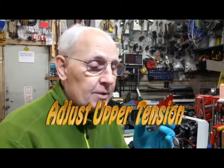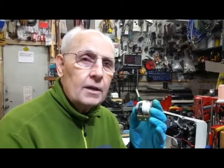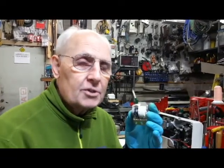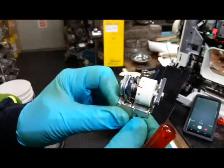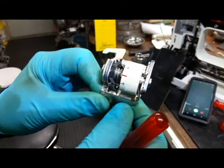There are problems with this tension — generally oil varnish, which is what we're finding largely at this point in time. Machine oils are now varnishing up. This is a top tension out of a Bernina 1080 machine. The same tension is found in all the 1000 series machines.